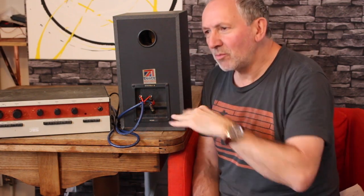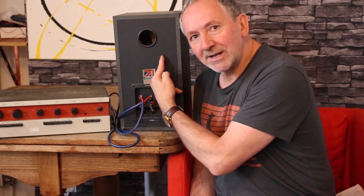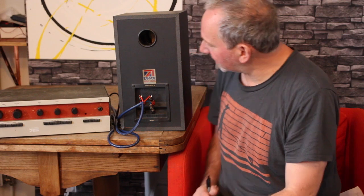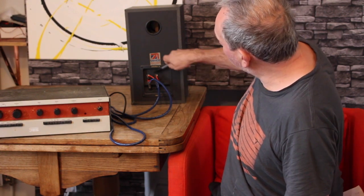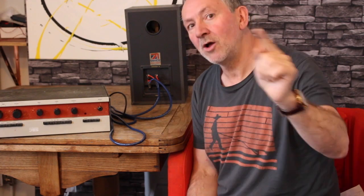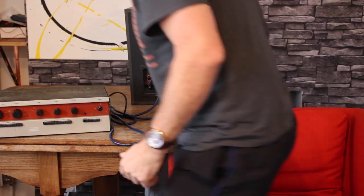It's a two-way speaker. What bi-wiring provides is essentially a thicker cable, which might help, and the wiring goes more directly to the tweeter instead of going through the crossover — at least one of the wires does. Now, if you don't have bi-wiring set up, you'll see metal plates connecting positive-to-positive and negative-to-negative on the back of the speaker. You've got to take those out — you don't want those joining them together.